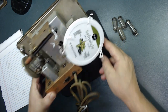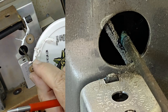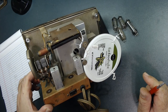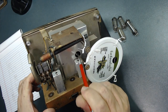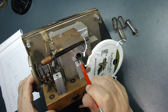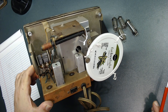Meanwhile, while checking underneath, I saw the clock wires. I'll put a picture up so you can see — the clock knob shaft has been eating into the wire insulation. See how green it is? That's not good. Somehow I need to get all that out and try to fix it. When I press it back it happens again. It ate through a bunch of wires and caused a short — that may be why the clock wasn't working.